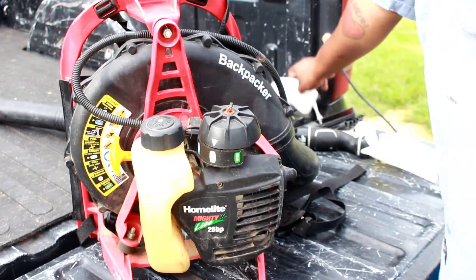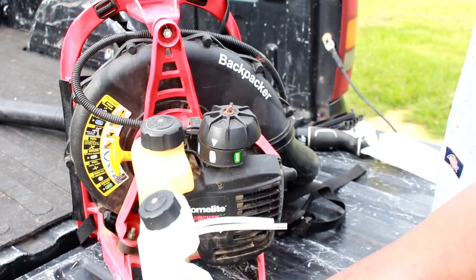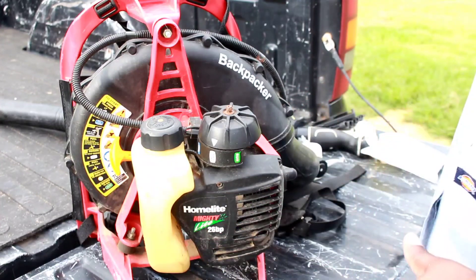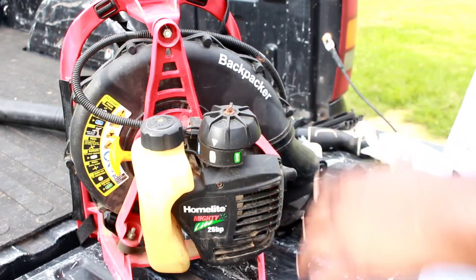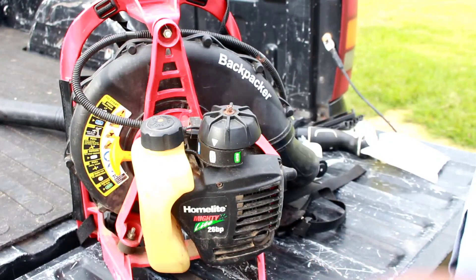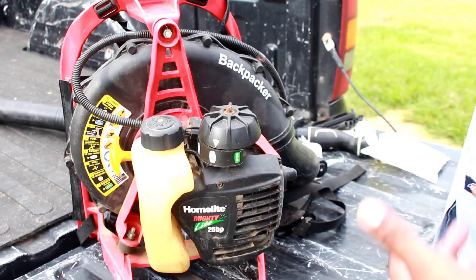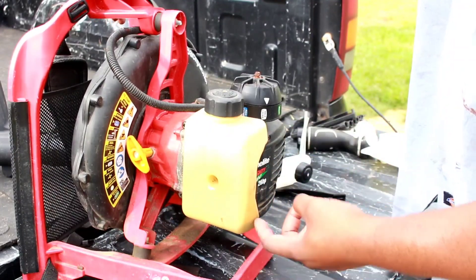He told me to go ahead and buy a new gas tank and replace it. I'm going to replace this gas tank with this one — slightly smaller, but that's the recommended one to get. He also said he was running it while it was still leaking, which is a major fire hazard — don't ever do that. He also said it was running real weak and wouldn't start. I asked how long it had been sitting and he said a couple of years, so the carburetor is probably gunked up. I'm going to check it out and replace it if I have to. I can tell it's leaking from this area here, so I'm just going to replace it.